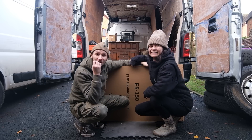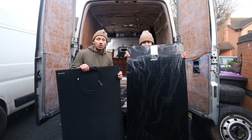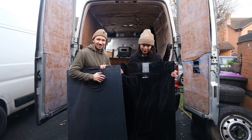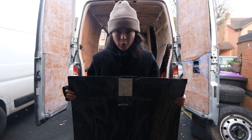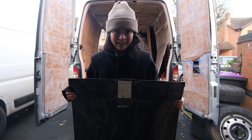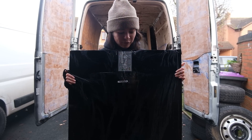Welcome back guys and this week's vlog is all about solar. We have gone for two flexi solar panels - we bought these panels off Amazon, they are £150 each and each one is 150 watts, so in total the van is going to have 300 watts of solar. The reason we went for flexi panels over non-flexi panels was actually because of the price. Although the price is more for a flexi panel versus a non-flexi panel, you have to consider the brackets to mount it onto the van, so actually with the brackets and a non-flexi panel it totalled the same as this.